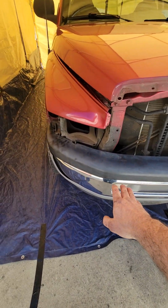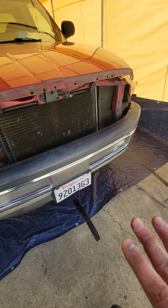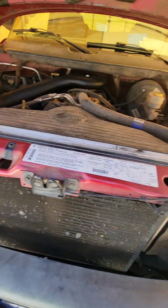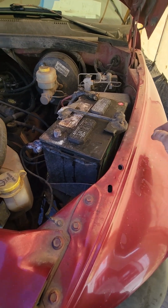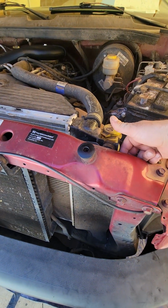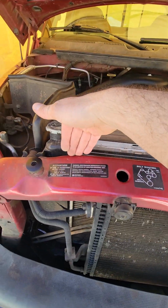I don't gotta strip this because there's nothing to paint below it, so I'm just gonna tape off and drape that, like with the tires and stuff. There's a dent here, also underneath here, same thing. When you get to painting these fenders like this and you're coming up, you want to get all the way, like I'm gonna back mask all the way from this to here, right? And then I'm gonna tape off like this if I think I need to.